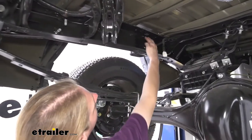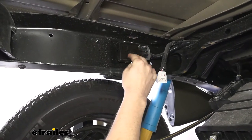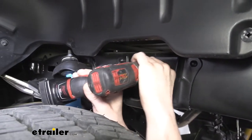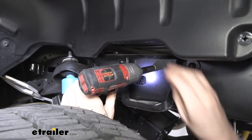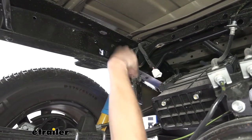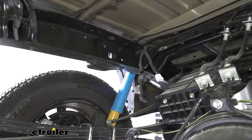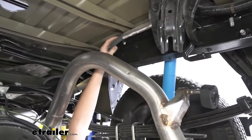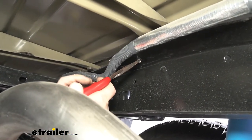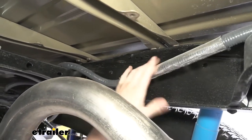We're back underneath the vehicle, and the module located on the driver's side on the inside of the frame rail just above your axle at the back — we're going to get this out of the way. On the other side of the frame there's a nut we're going to remove with a 12mm socket. Once you've got that nut removed, we can pull that module out and set it to the side — we'll leave it connected and just let it hang down. We'll reattach it later, but we need this area clear to get our components in. Directly across on the passenger side, we're going to have a wiring harness — we'll use our pliers to squeeze the ears on the clip so it pops up, and we can pull it down out of the way.